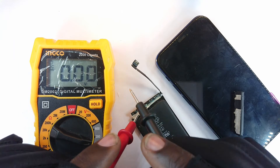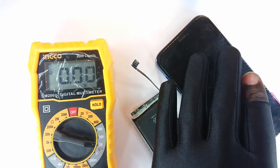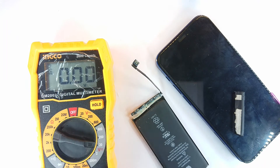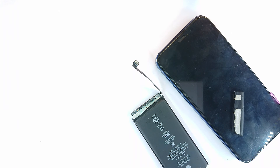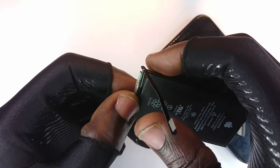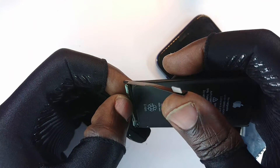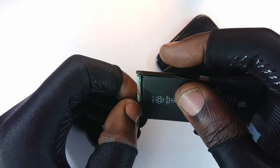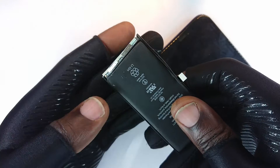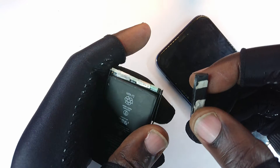So as I was trying to restore this iPhone through iTunes, it was the faulty battery that caused it to not proceed well. Having confirmed it was inevitable that I would need a battery to proceed with any other repair — and I didn't have a replacement or test battery — I decided to go and buy one. Also, the peer suggesting it was a NAND chip failure also needed me to have a good battery before they could help fix that.